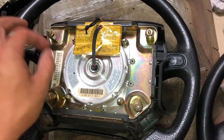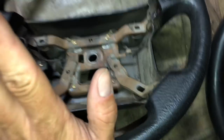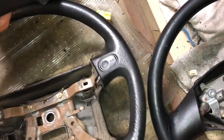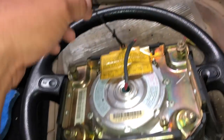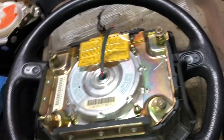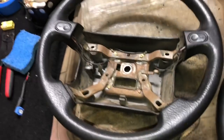The connectors are different on the airbag. There's a little string here that's mounted to a tab — when I pulled the airbag out it just sort of held itself by the string. It didn't put any weight or pressure on the connector. I thought that was a really great trick. So we cut this OEM-style connector going to our clock spring, and we also cut off the connector on the other airbag. This old connector is now trash. Make sure you always store these face up so they don't shoot off into the sky.